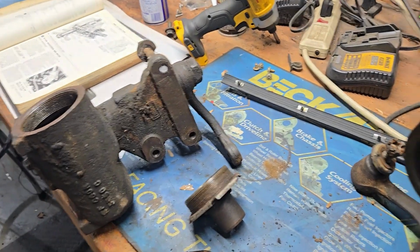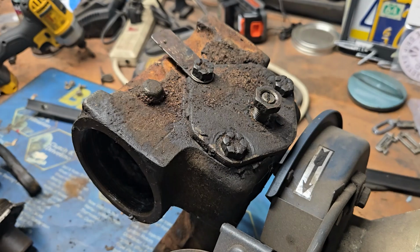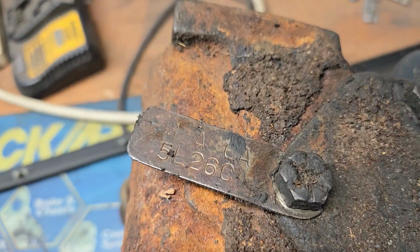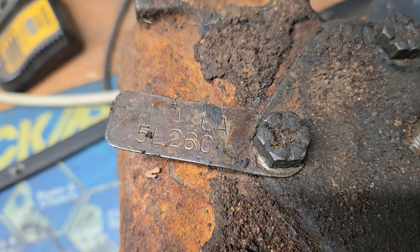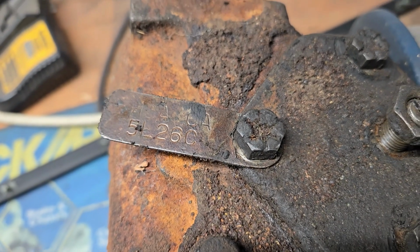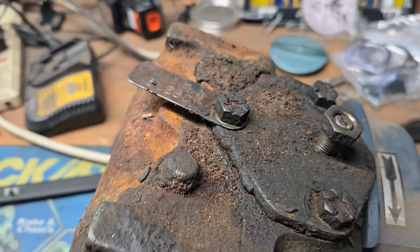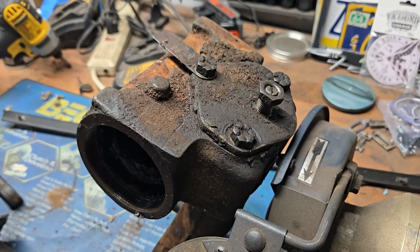Now, the steering boxes on these cars for the 60s Fords are pretty much all the same in appearance, but they're not interchangeable. And we'll get to that more here in a second. There is a tag on every steering box, or there should be, with codes on them. And I'll try to remember to link in the description below a link to a page that shows what all those steering boxes actually fit. And that way you can kind of figure out what interchanges with what.